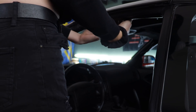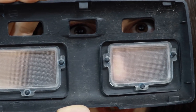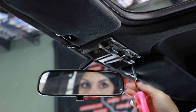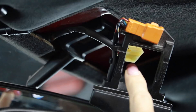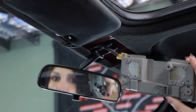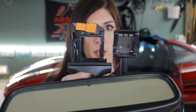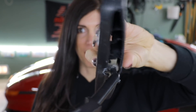It's the same for the most part though. I'm gonna pop these T-tops off so you can see what I'm doing. No tabs were harmed in removal of this piece. It took me a while to figure this out when I couldn't get these lights to work, but the ground for these lights is actually one of these screws. See right here — the LS400 rearview mirror mounts to the roof of the car, just like the MR2, instead of to the windshield glass like almost all other cars do. This back plastic area is actually what's coming in contact with the mount for the LS400 rearview mirror. Trimming this top portion by the orange sensor off will allow it to bolt up exactly like the factory rearview mirror, and then I'll have a mirror that is not falling apart.